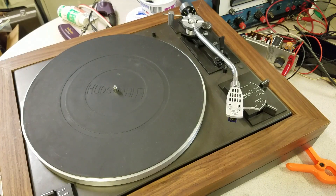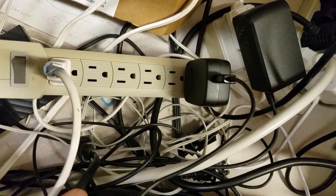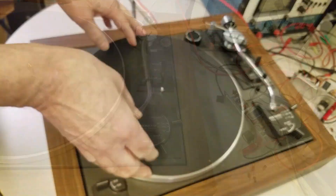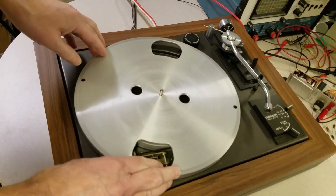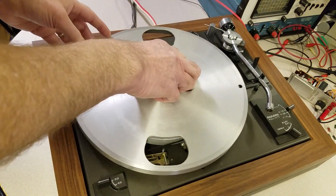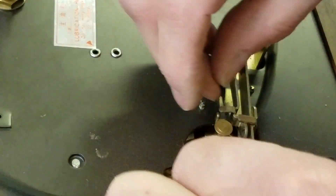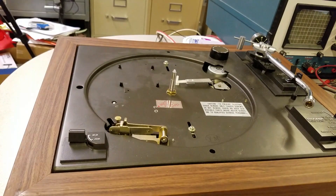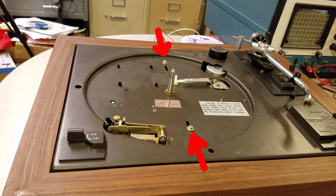Next, it was time to remove the turntable mechanism. The first thing I did was to unplug the turntable from the mains. Then I removed the cartridge head and locked the tone arm. I removed the platter mat so I could access the belt. I carefully lifted the platter off of the spindle while I slid the belt down and then set the platter aside. At this point, I removed the belt from the motor — I slipped it out of the speed changing guide and then off the motor capstan. To get to the motor, I need to lift the turntable off the base. There are a couple of restraints that must be disengaged by loosening them and then moving them toward the center.